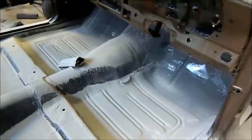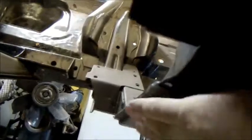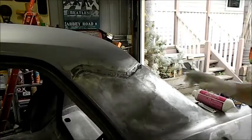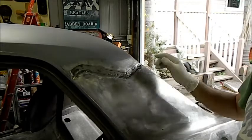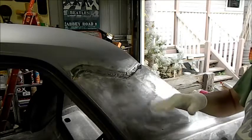I really wanted to get the car painted by Easter. This is the inside of the bottom of the old cross member — the engine cross member. The six cylinder apparently had a flat steel one like this, or at least this one was flat years ago — it's buckled now, so I put this 351 GT type one in. That's all been plug welded so that's nice and strong — that looks the business. Now there are three types of filler going into this car. I'm going to use a stainless steel filler — a metallic filler — for this area here. I don't want a big thick area of filler there because it can break down if it's over a quarter of an inch thick.